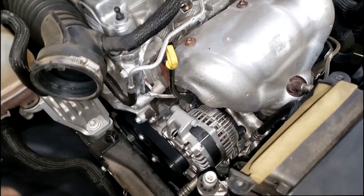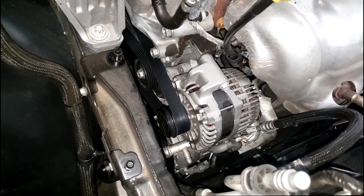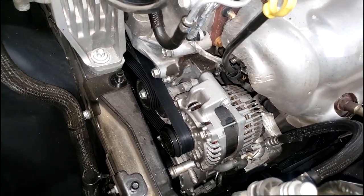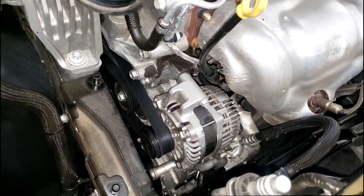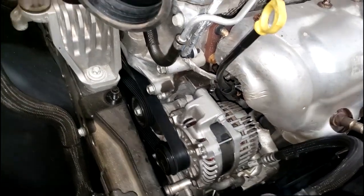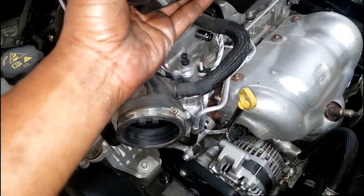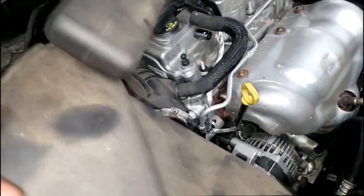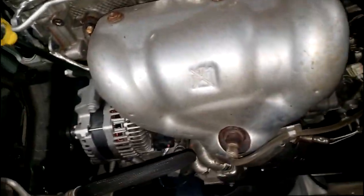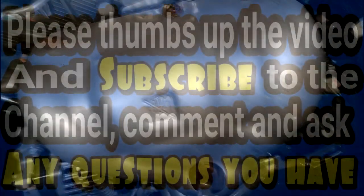You've got to have a place to start — I know it's an expensive starter, but we've got to put a compressor on before going any further. I'll evacuate the system fully with the machine — it's an automatic process. You punch in your numbers, tell it what you want to do, and it goes through the complete process. The machine is the end-all — if the system holds up, there are absolutely no leaks, because the machine checks for leaks before putting freon in. I'm writing this estimate up and we'll see if they approve it. It's hot, so there's no problem getting approval for AC work. Stay tuned.